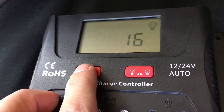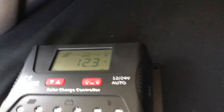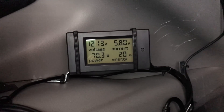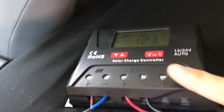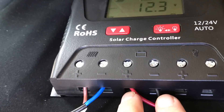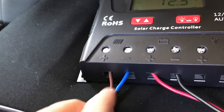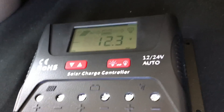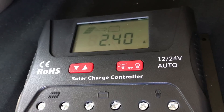There's a temperature reading in Celsius, an error display, and I can post a video on this panel since I like it — it shows everything on one screen. I could reroute my 12-volt electrical panel into the load output so everything's in one place, but wiring is very easy: plus and minus to the 12-volt battery, and plus and minus going to the panel. Tricky note: the blue wire is actually the ground, so I put black tape on it, and the brown is positive.